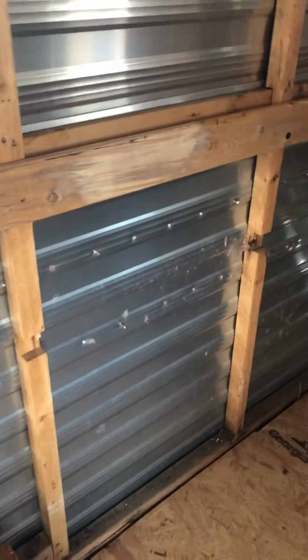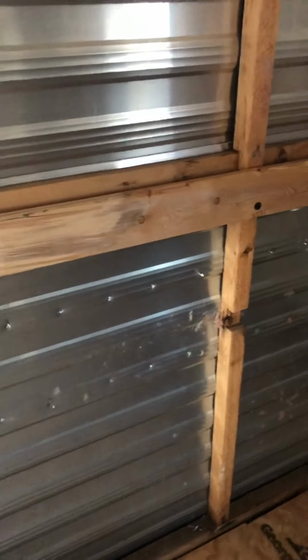But when I talk about the pinholes, this is where the trim comes through. So you see that the screws go right through the skin. So if you don't have butyl tape on the outside, then you're going to have pinholes. And like I said, I did everything with silicone for now, just to get it buttoned up so I could use it. But that needs to come off, and then butyl tape, and then I was going to seal it from the inside with a rubber undercoating to get all the little pinholes and pricks and things that may cause issues later, plus all of the seams, and then all of the curved places were going to be expandable foam, like that.